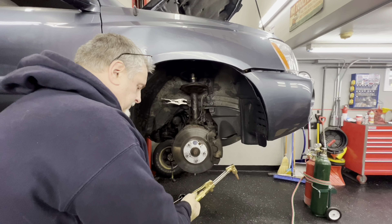We have a clip here so we can slide this clip off and get a 12mm socket set up on this and get it to crack loose. We soaked everything with penetrating oil before we started. And this is a job you can do in your driveway. You can get up on jack stands, and when we go to pull the strut out we put a little pry bar underneath the control arm so that we can line up the bolts, these big bolts, to go back in.